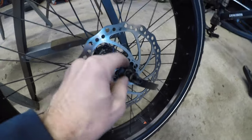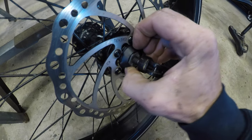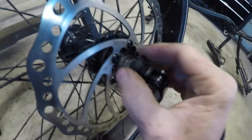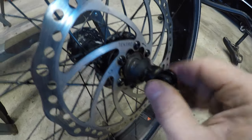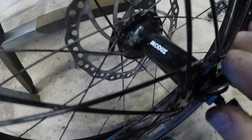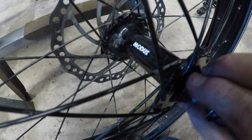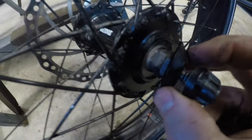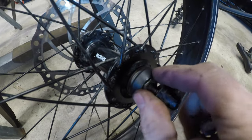After I took the bike apart, I took the front wheel off and noticed it's got this rubber dust cap seal. I already pulled it off one side and looked underneath - it's really clean underneath there, did a very good job holding all that mud out. Now here's the opposite side of the rim I haven't had off yet. It looks pretty clean too - about as clean as the other side. These seals are going to be very important, so when I put them back on I have to make sure I get them on there good because I'm going to be back down in that mud before I know it.